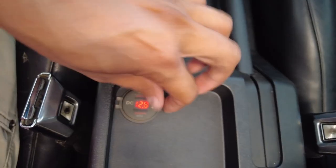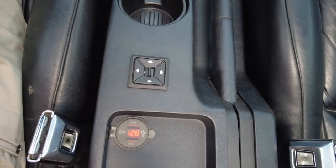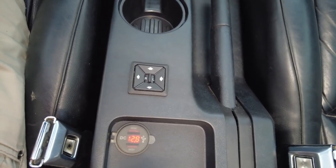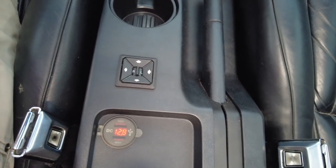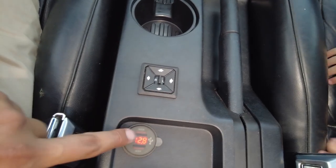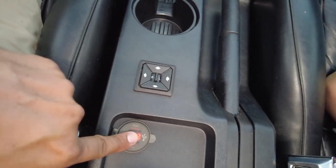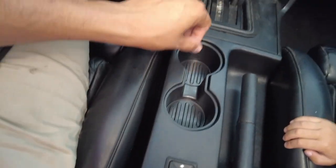So let's talk about the importance of being able to see the voltage. 12.8 means there's a 100% chance your vehicle has a good battery. As soon as the voltage drops to 12.35, you have a 60% chance the vehicle is going to turn on. At 12.25 you're down to a 50% chance it's going to turn on without a jump. At 12.06 your possibility of turning on the car is now 25%. If you walk up to the vehicle and it's down to 12.0, you will need a jump — don't even bother trying, don't hurt the engine. And if it goes all the way down to 11.9, your battery is toast and you need a new battery.